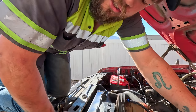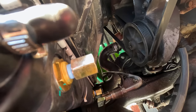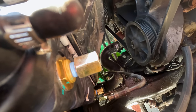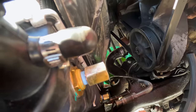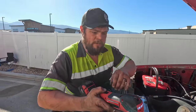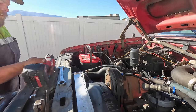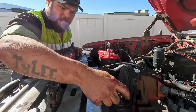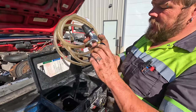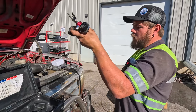Half inch to about an inch gap between the fan and radiator - that should help a lot. Getting antifreeze up my sleeve - better than up your nose, and it really burns when it goes in your eye. Colton's down there getting that hose clamped tight. This right here is the filling tool - what it does is vacuum all the air out of the system.